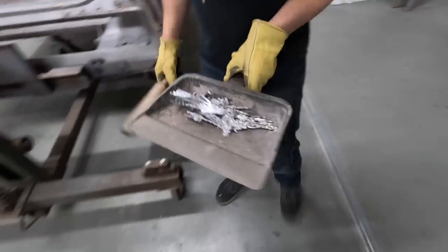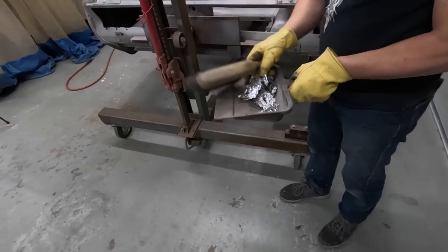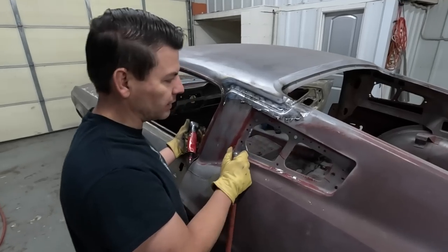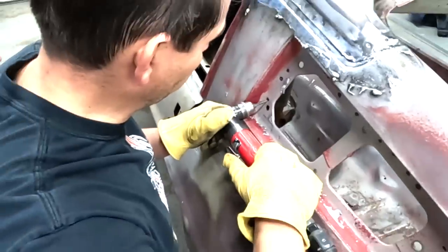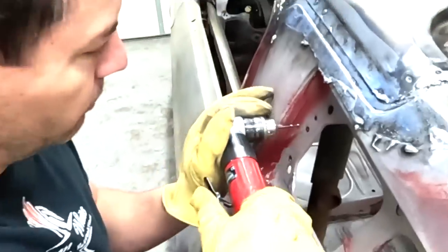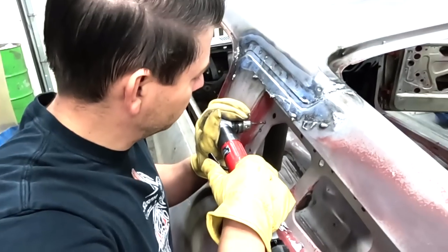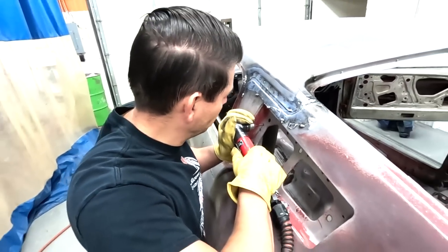It's a little different lead, it's got a different alloy, and it's got acids in it to stick to the steel. You can get that drill bit right in the center of that weld. Then I'll drill a pilot hole in the center of them with an 1/8 inch bit, and you'll get the whole thing drilled out instead of it trying to move around on you.